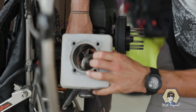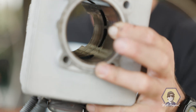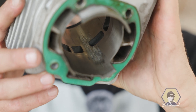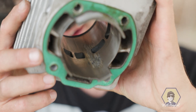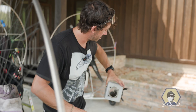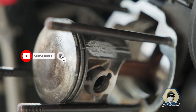I got the cylinder off. It's definitely got a little scratch mark in the wall — two sides. It has this special Nikasil coating inside, so you can't hone it out like old cylinders without the coating. If you take a look, you can actually see the rips in it. We can try to buff out that stuff from this Nikasil coating, maybe with a brass brush or something soft to clean it up. But until then, let's just keep tearing it down. This is the real damage — the piston side looks really machined, silvery, and shiny.